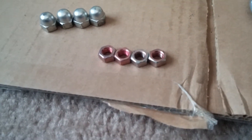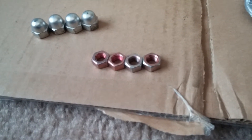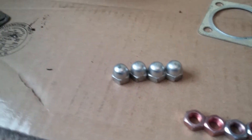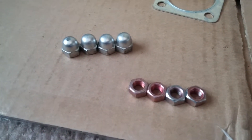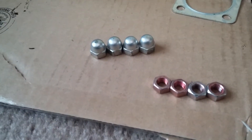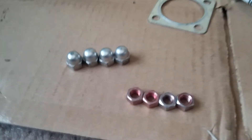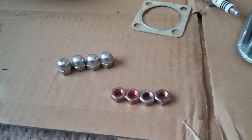I got a lot more and they're a lot stronger — I think 8.8 tensile strength. I don't know what these can handle, but a lot of people have problems with them stripping out or getting stuck on the head studs if they tighten them down too much. It'll get to the point where it won't turn anymore and you can possibly strip out or break your head stud, which is not a repair that you want to do.